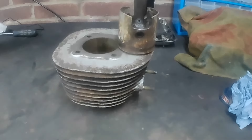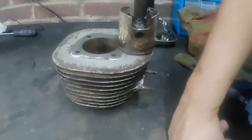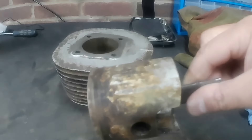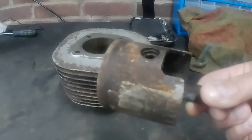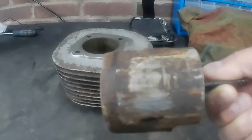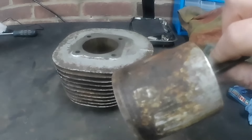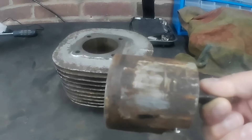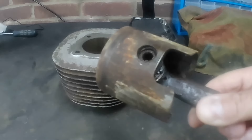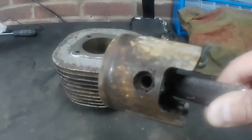It finally yielded — this is Peter's B175 cylinder barrel and piston. These things were absolutely welded together; the piston was completely seized into that bore with corrosion. This is what standing outside in a garden since 1977 will do, but I think it could have been an awful lot worse. It's taken quite some time to get apart — I've just been very sympathetic, inching it a bit at a time with more penetrating oil, more heat, and repeated cycles.